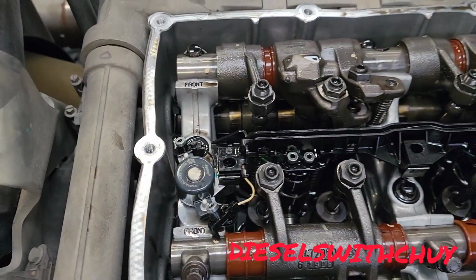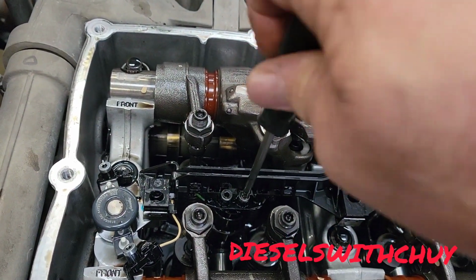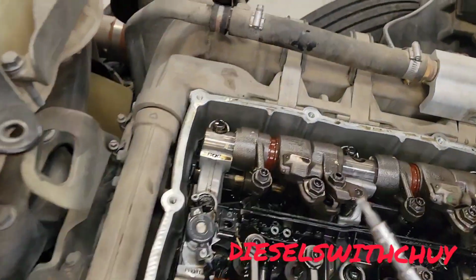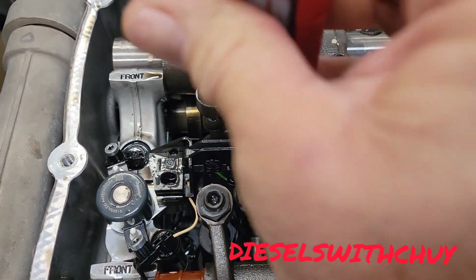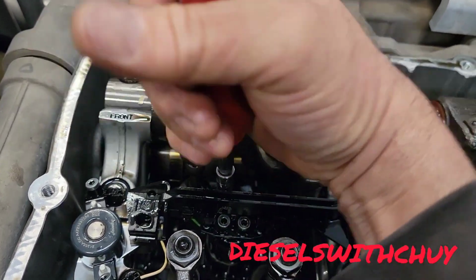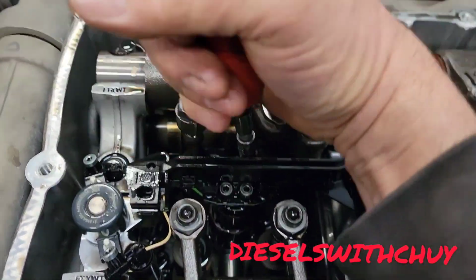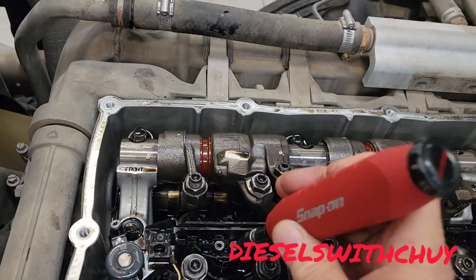Now I already tied the solenoid. Okay. I'm gonna put all the way down this bolt. Okay, all the way down. The back, there are 4 bolts. 4 bolts, my friends. And then I'm gonna torque. It won't go. Look at this torque. After you do, it won't go no more. Okay, right there. This is torque already. Okay, this is torque. 12 foot-pound, and I'm gonna torque this one.